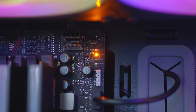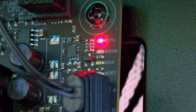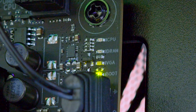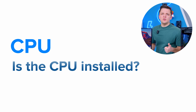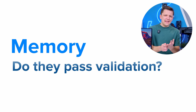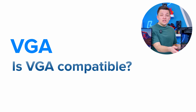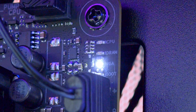If the system won't go into BIOS, watch those four debug LEDs. They illuminate in sequence: CPU, memory, VGA, and boot. The board is checking: is the CPU installed, too hot, or compatible? Is the memory compatible and does it pass validation checks? Is the VGA compatible, does it have power, is it in the PCI slot correctly? And then it jumps into boot.